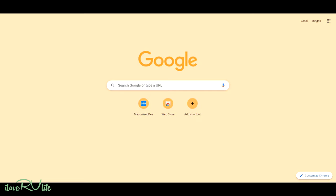Before I get started, I'll just cover one thing. You will use an app that you will download called Synology Assistant. Using Synology Assistant, you will click on that and it will show the IP address and the device. You'll click on that, and it'll ask you for three pieces of information: naming the Synology NAS, giving yourself an administrative username, and giving yourself a password. Once that has been done, you can use the access to the system to start your configuration. I have already done that.